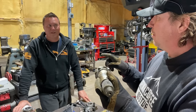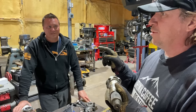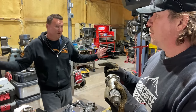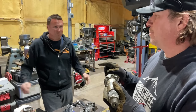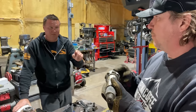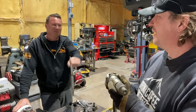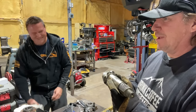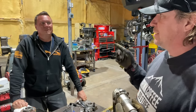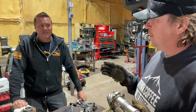It is a torque multiplier for sure, yeah. Where this one, if it turns less times per rotation of a ring gear, you're putting less torque into the one rotation of the tire. Yep. Which is also putting more stress on your axle shaft. So that's why a lot of the time we'll put chromoly axle shafts in. If you run the deeper, the more torque here. Lower, higher numerical, slower ring and pinion ratio. But at the same time, even though it's multiplying torque downstream to your axle shafts, it's reducing torque to your drive shaft. Could you say that? Yeah, you could say that, yes.